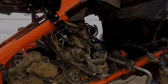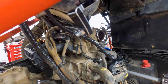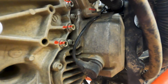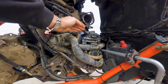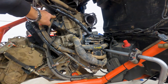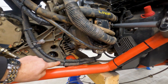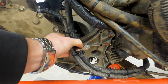Continuing underneath — got the upper ends of the AN lines done, took off the side cover plate, and got the connections all torqued down. The bottom line snakes through there; it's very close but it works. The exhaust came down right where the fuel line ran up to the fuel rail, so I rerouted the fuel line so that instead of coming up right back there it stays low, comes over here and up through there. Also used a P-clamp to secure the line so it can't rub or chafe on anything.